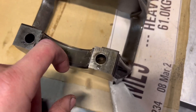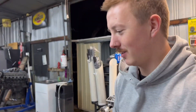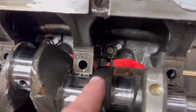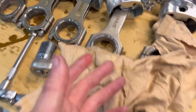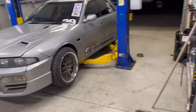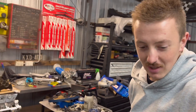You can see the bearings - just a little bit of scoring, very very minor. I'm so happy. New oil pump, new bearings, new rings - good to go. Now obviously there are some issues. I'm finding some weird pitting on the rods and on the bottom of the pistons. I believe that's because when I was doing the head drains on my sump I noticed a few of the oil squirts snapped, so I spaced them down a little bit because the pistons were hitting them. I'm pretty sure that's just from debris bouncing around underneath. Very lucky to get away with that. I'm going to pop the crank in, do a big cleanup, and then start ordering parts to get ready for Battle Royale.